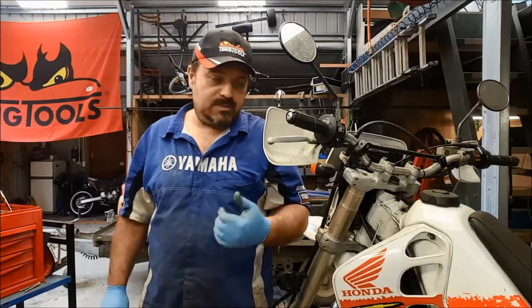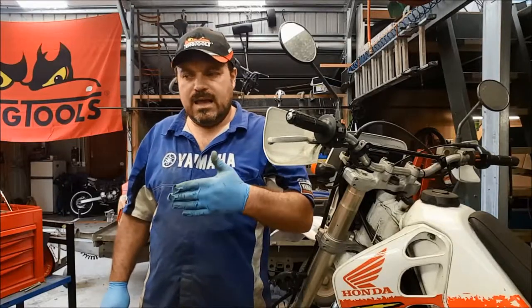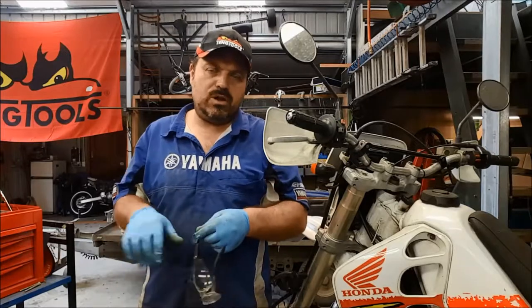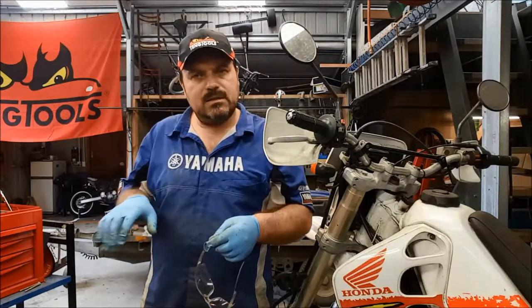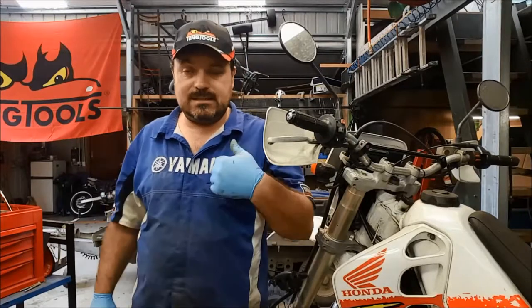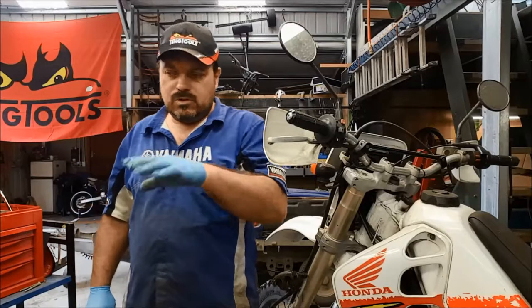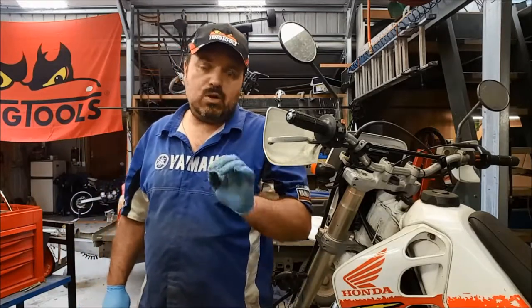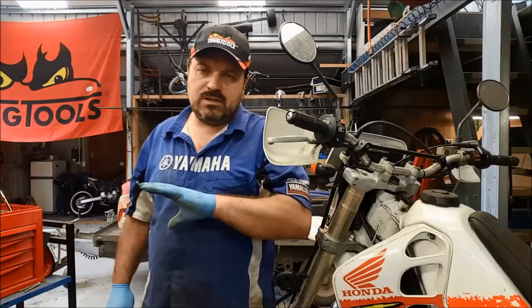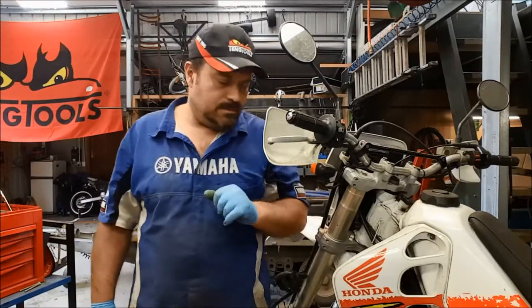It's a very bad thing, especially in the case of a motorcycle, where the pistons are very small, and any additional travel, any additional retraction of that piston is going to cause the brake lever to be a lot closer to the handlebars when you apply the brakes. And that's bad, and if it's really bad, it's a warrant fail. That's excessive travel. So when you build up the calipers, and we'll do this a bit later on, you should always, in my opinion, always use brake fluid on the main square section seal. Those seals are designed to work with brake fluid. Let's put a little smear on there, build it back up, job's a carrot.